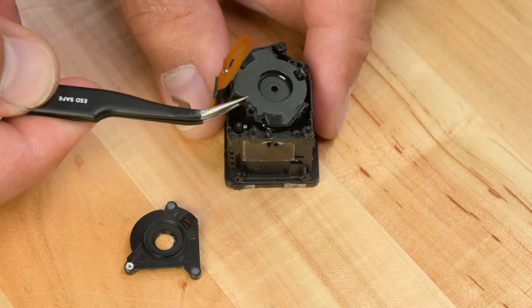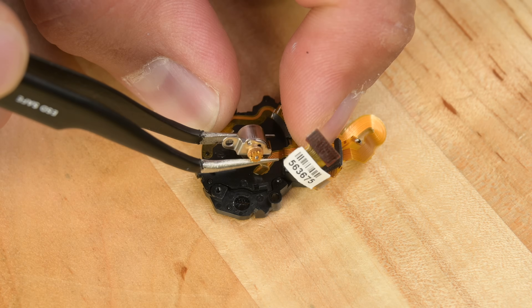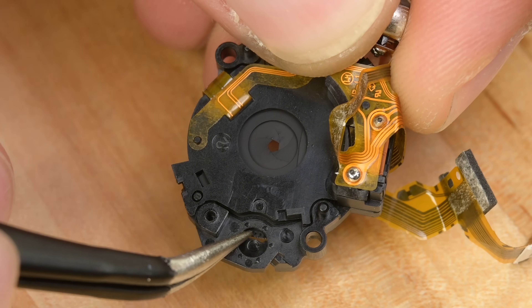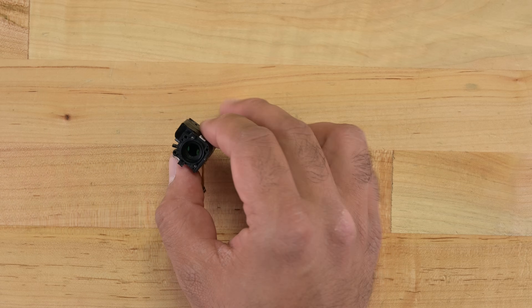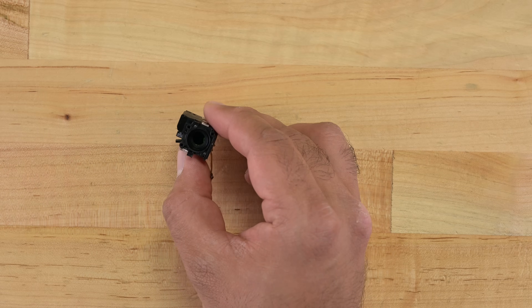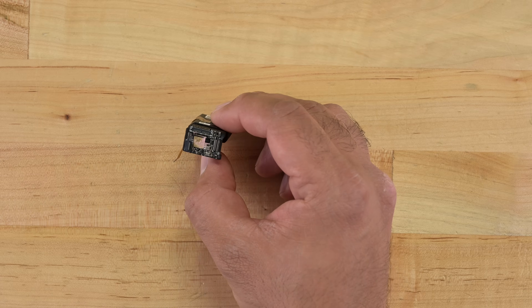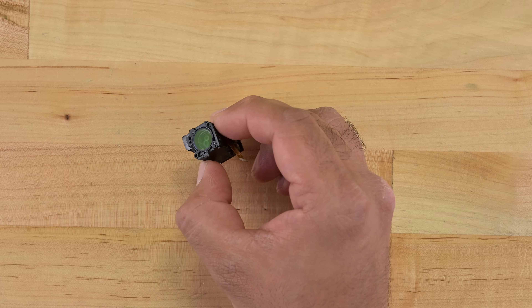Removing the 24mm lens stack reveals some more interesting tiny engineering. This motor-mounted cog drives the larger recessed cog that controls the main camera's aperture. We're left with the newest addition to the camera assembly — the 48MP 70mm lens, which sits between the Hasselblad 4/3 CMOS and the smaller half-inch CMOS on the 166mm telephoto.